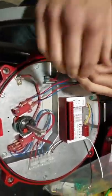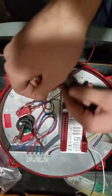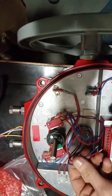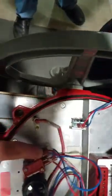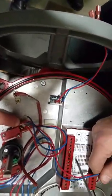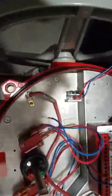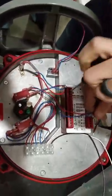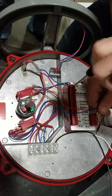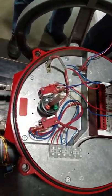You're standing in my position looking at it like this. You have your lower and your upper set of wires. Your lower wire set is going to go together in the third up from the bottom portion of the wiring block. So it's these here? Mm-hmm. The bottom are going to go in the third set up from the bottom together. And this is extremely tricky to line up. Yeah, these holes are smaller than the ones on the other servo pros, so it's a little bit of a pain in the ass. A little bit of a tight squeeze.